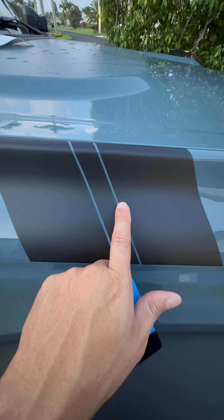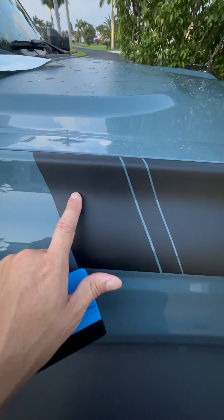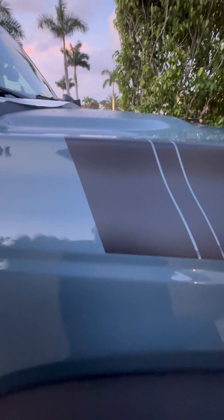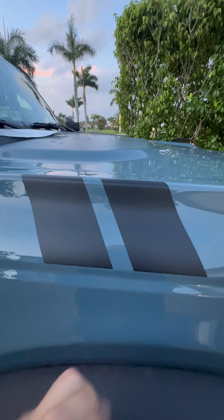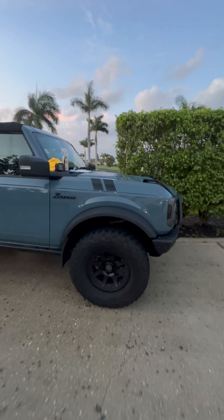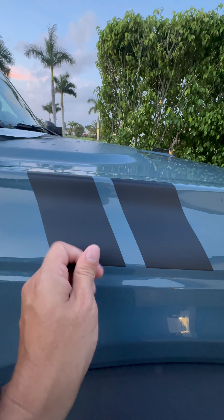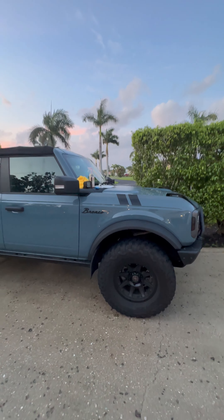So you have the very wet vinyl, you put it down, make sure it's where you want it — basically the top of this fender line going all the way up to that seam — and then you just squeegee it out. Then I have this little alignment strip in the middle. I made sure there was just a small gap in front, small gap in the rear, got that on there, then put the rear stripe on the same way going from that seam down to the top of that fender indention. Then I just take out that alignment strip — this is what the customer wanted, just a little racing stripe. I have it spaced about an inch and maybe a quarter apart. You can make that gap bigger by using that alignment strip and making sure the same gap is in the front and the rear.